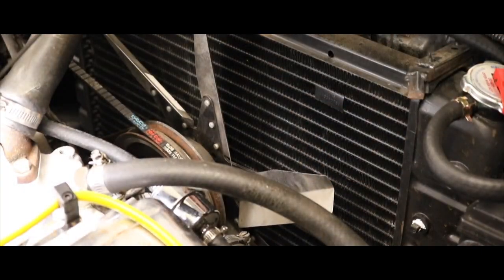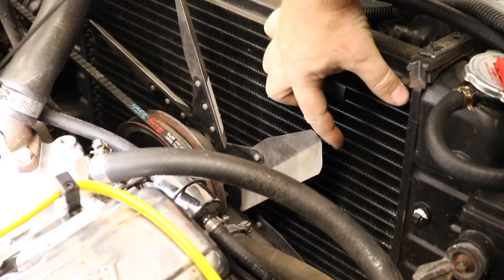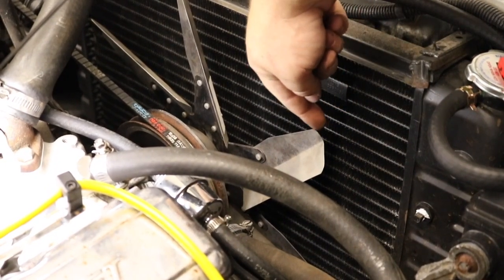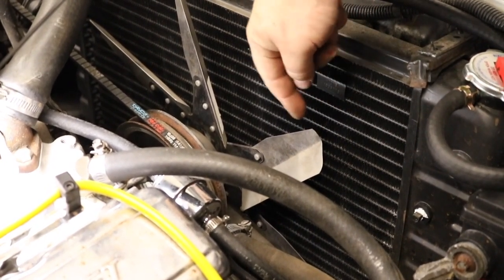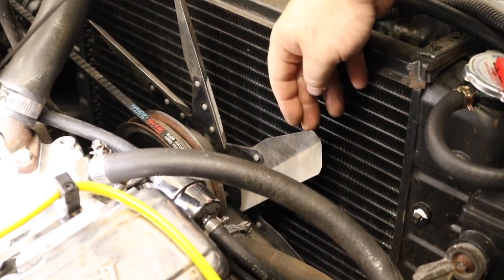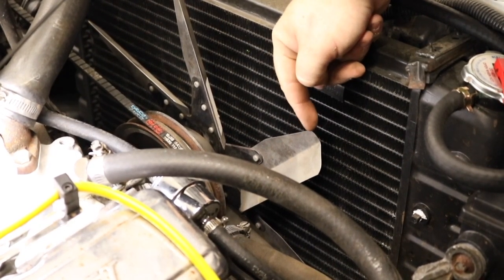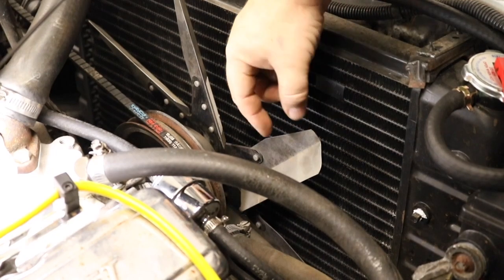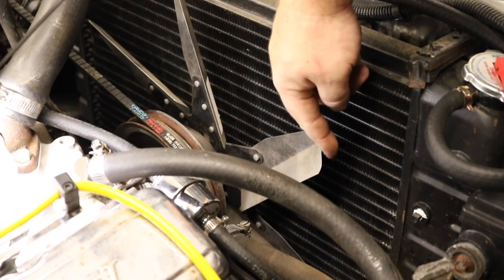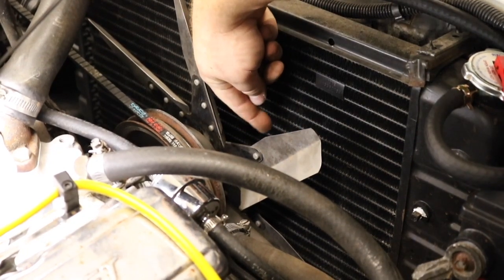If you really look at the fan, you'll notice that as it moves through its arc, it's missing this huge chunk, right? But that's only if the fan could pull 100% of what it's directly in front of. But that's not the case, because this fan, much like a propeller blade on an airplane or the rotor blade of a helicopter, produces vortex rings on the end, which makes this last portion of it a non-lifting surface. So the wind that's coming off of it just swirls back and gets recycled. So really your cooling is just coming from in here.